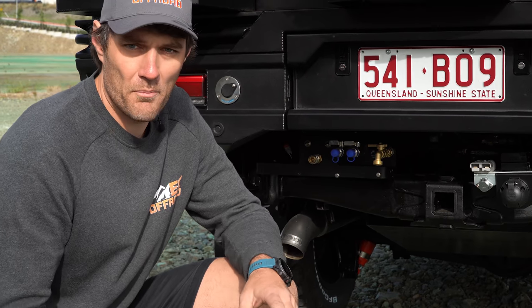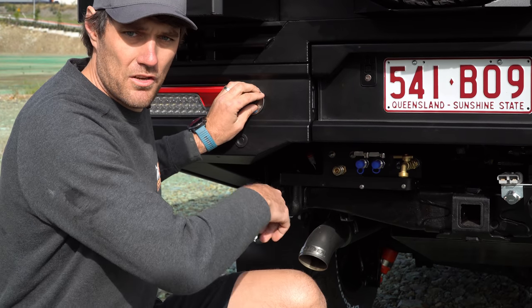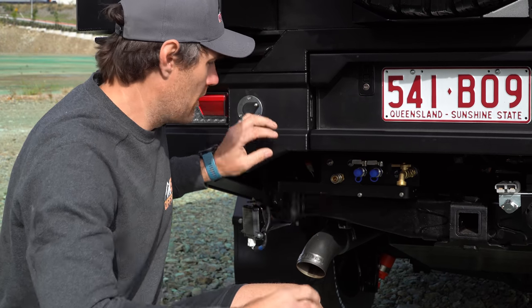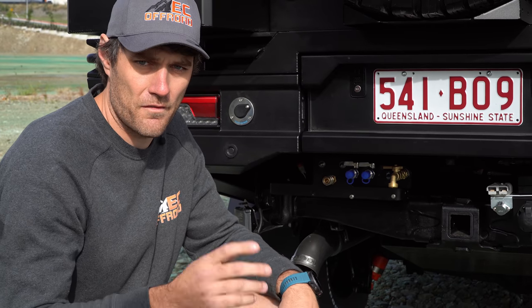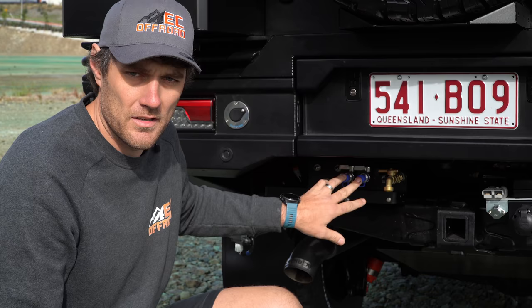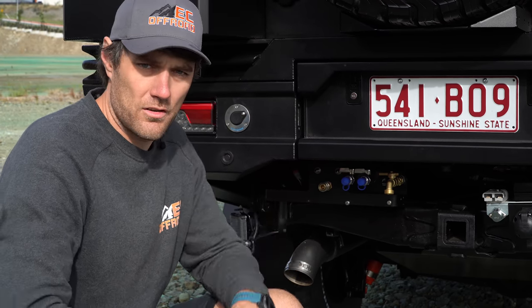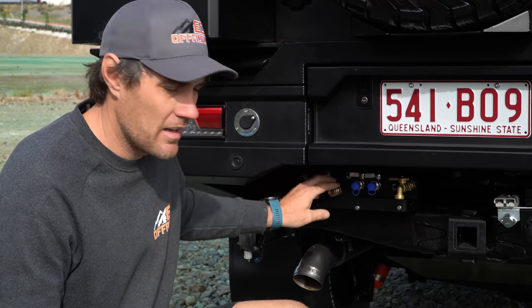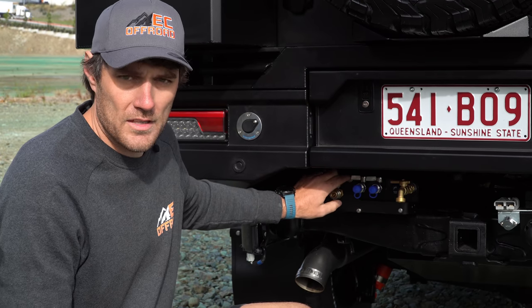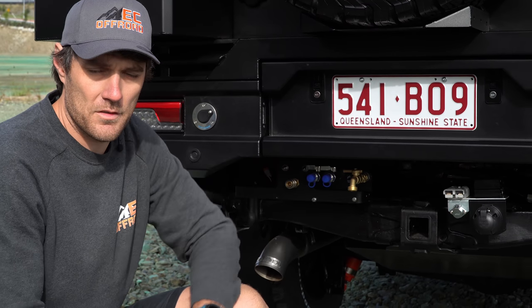This pump system is pretty complex but we gave him exactly what he wanted and it has worked a treat. We've got the wash-down outlet which he can use via a pump for his shower that clips on at the back. We've got a gravity-fed drinking water tank from the front — not running through any pumps, just gravity-fed for drinking water. We've got an inlet and outlet separate Seaflow saltwater-rated pump, so he can hook up to any water source — bucket, ocean, river — suck in and pump out to clean his fish, clean the car, whatever. We've got the air fitting out here, manual overrides for the airbags, all your Andersons for different trailers, and two caravan cameras for his van.